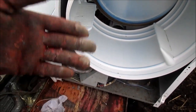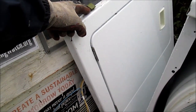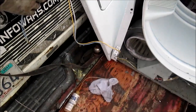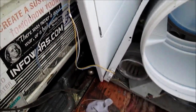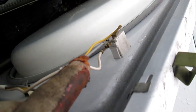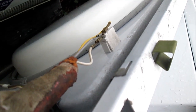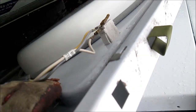Once you've pulled it back, the top will drop down so that you'll clear these clips. When you take this off, you'll notice I've disconnected the white wires but I've left the wires on the door. This is the wire configuration for the door on this particular model. You have to be very careful when you remove this door because if these wires take any brunt of force, they may break that switch. So be careful with that.